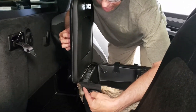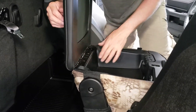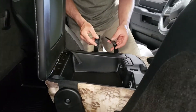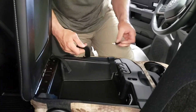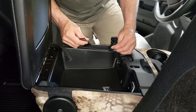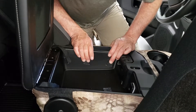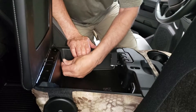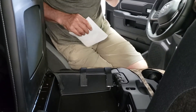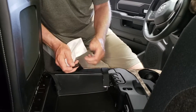We have a small half-inch piece of velcro that will fasten the carpet here, and another one on this side. Feed those velcros through — you'll notice you have a couple of extras in case some don't immediately stick. Tip the velcros inside the cavity and take note of where they're going to lay. Prepare the surface of the plastic to accept the adhesive velcros using rubbing alcohol.